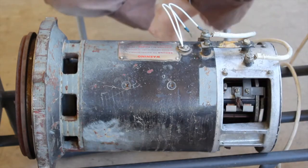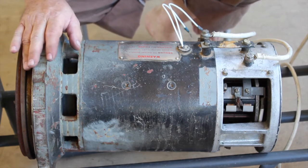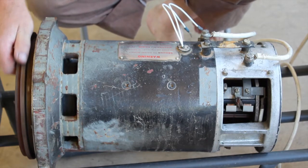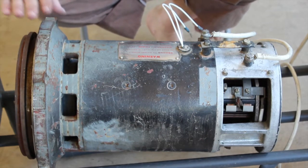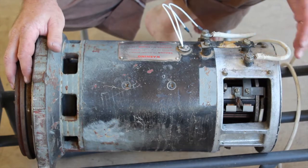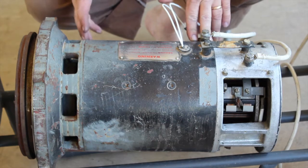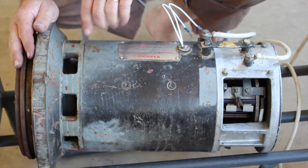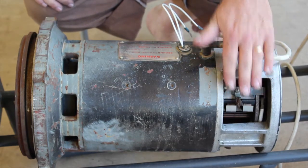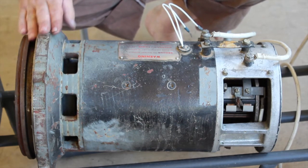To whoever may be interested, I wanted to show you my GE 9-inch motor. It's a 9-inch GE motor with an end bell that's designed for the air-cooled Volkswagen. It has no aux shaft on the end and no internal fan. The armature is a little bit longer than probably about normal for any 9-inch motor. It needs forced air cooling, and we do have the covers that cover the brush holders for hooking up the fan for cooling the motor.